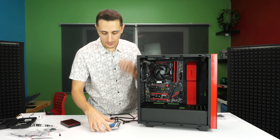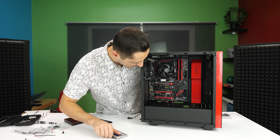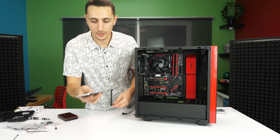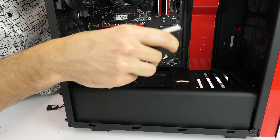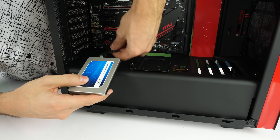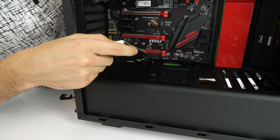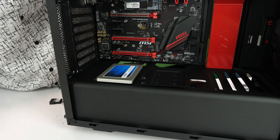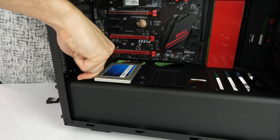Now flip over the case. We know which cable to use, so disconnect the power cable and drag it from the back through the front so we have access. Grab the SSD, slide in the other cable, and hook the power cable up where it belongs. Once connected, flip it over and slide it back on the tray — it should snap in place so it doesn't move. Put back the thumb screw. That's how you install your SSD.